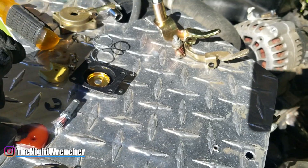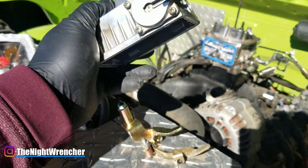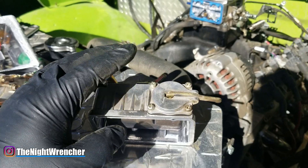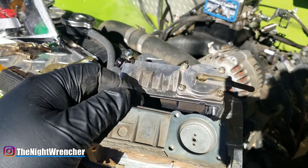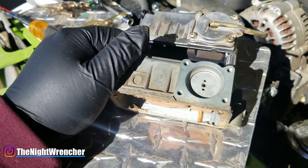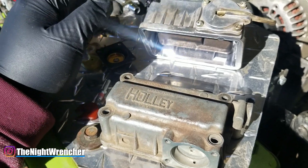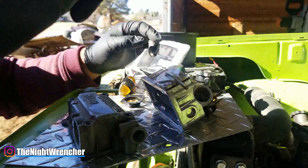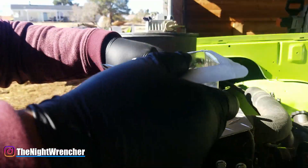The second thing I want to show you is that this is a dual feed style bowl with center hung float bowls, and it currently has a 30cc pump assembly. You can install the 50cc upgrade not only on center hung float bowls but also on side hung float bowls. It's pretty much the exact same pattern. If you were to install the 50cc upgrade on a 4160, you'd get the exact same result as installing it on a 4150. It doesn't matter if you're using the older or newer style of carburetors — it all works exactly the same. I'm going to replace the four bolts, remove the assembly, remove the diaphragm and spring, then install all three in the 50cc variety and get it back on the carburetor.